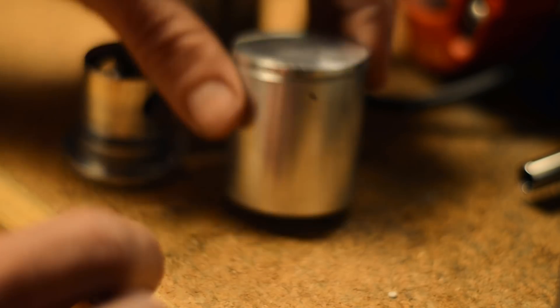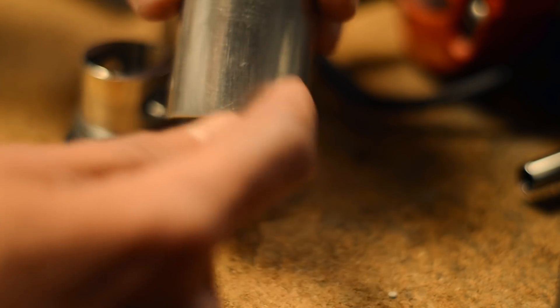And this makes it so that you can stick it into the piston, and there's a limit to how much it can expand. So this ring with this piston is kind of the key for this 100% of bore exhaust port to work. Looks like this when it's assembled. I'm missing the cutouts for the transfers here, we'll do that later, after we know it works.